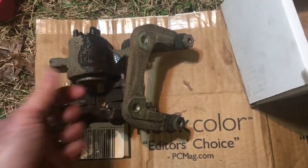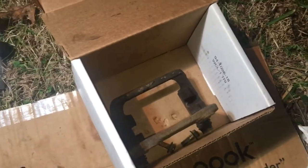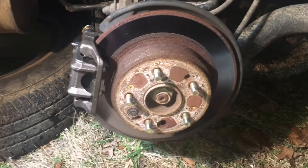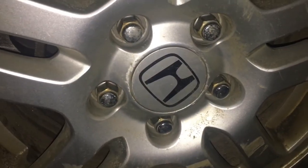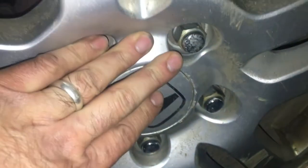Something to remember: save all the old parts because you paid a core charge for the new caliper. I paid a $75 core charge at my Advanced Auto and if I bring the old part back along with the receipt I will get that money back. Now we're going to put the wheel back on and go give it a test. Before you get going, pump your brakes a couple of times just to pump it up and make sure fluid is flowing. One big thing about auto maintenance is checking your work — the brake caliper was dragging before, causing everything to heat up, and I just felt this and it's nice and cold.